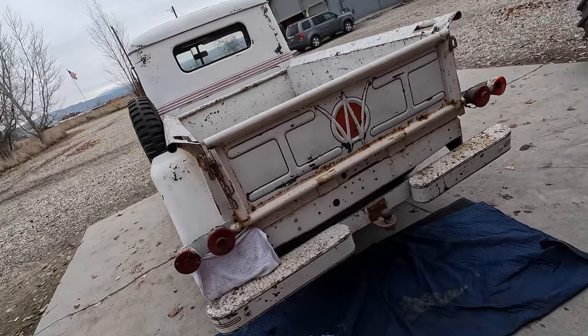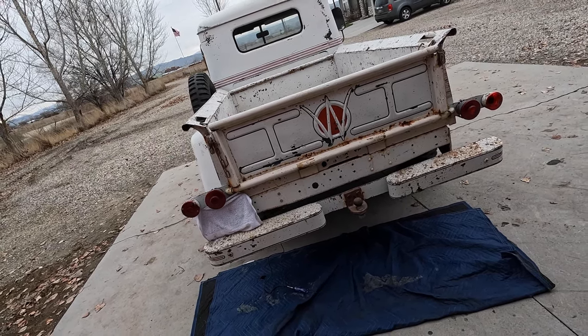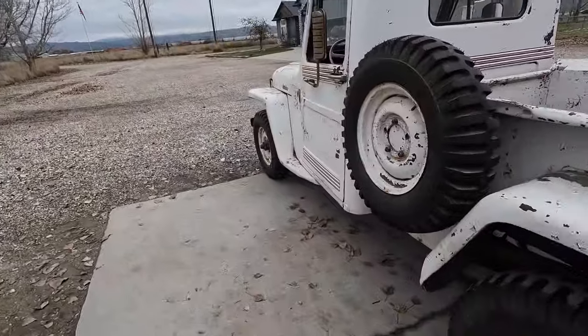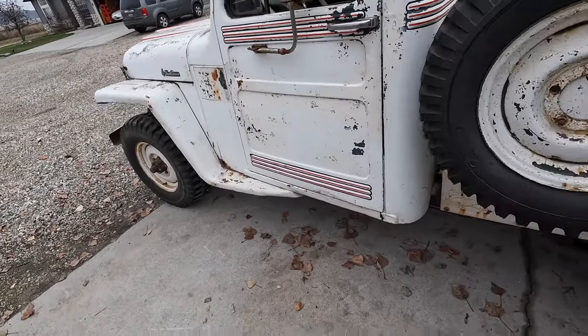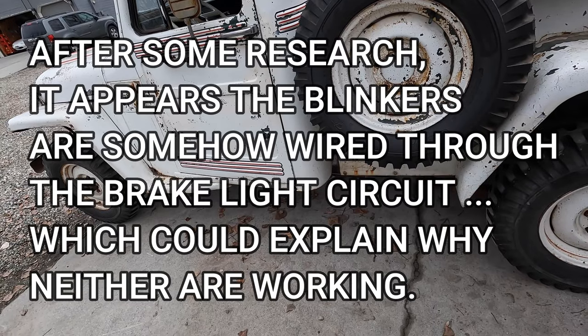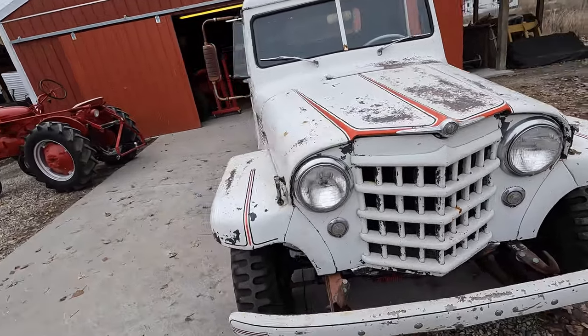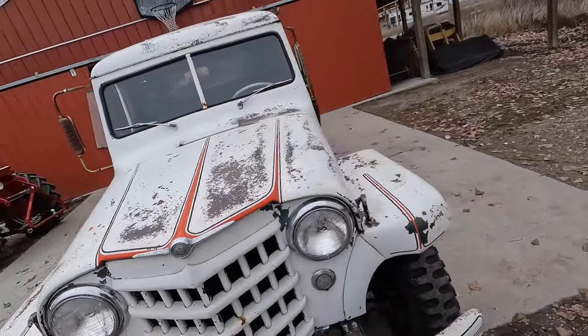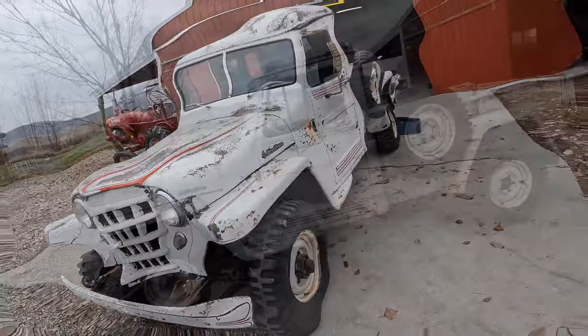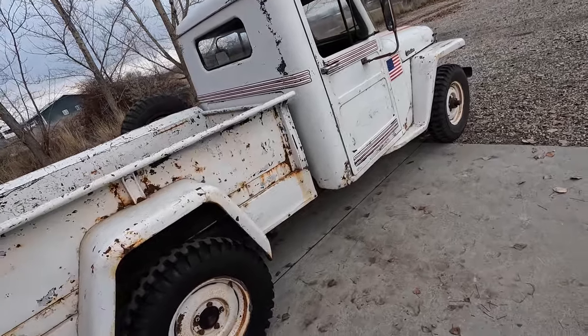The last thing to check is the brake switch on the master cylinder. I can get up there again with my lovely assistant in the cab and I'll have her press on the brake pedal. I wasn't able to get it on camera, but I crawled underneath the truck and put the probe on the master cylinder brake switch, and I'm getting power coming into the switch but there's no power coming out of the switch — kind of like I suspected. If anybody's wondering why I haven't checked the fuse box yet, well, this truck doesn't have a fuse box. Come to think of it, I'm not sure I've seen one single fuse as I've been poking around on this thing so far. So I'll wrap this up for now — I'll get the electrical components ordered, and then when my hand heals up all the way, we'll go ahead and get the brakes inspected.